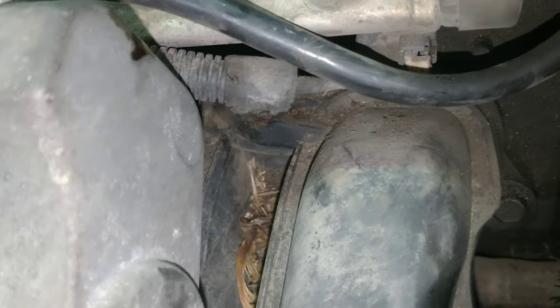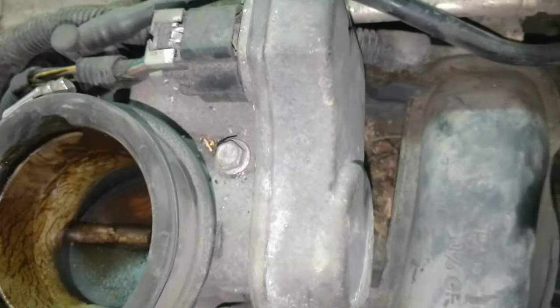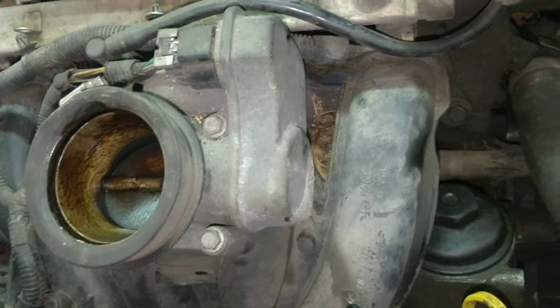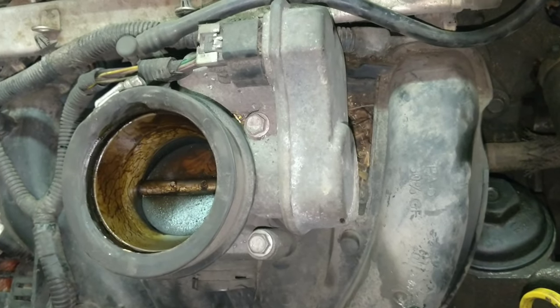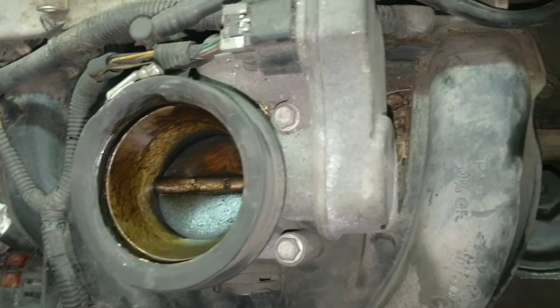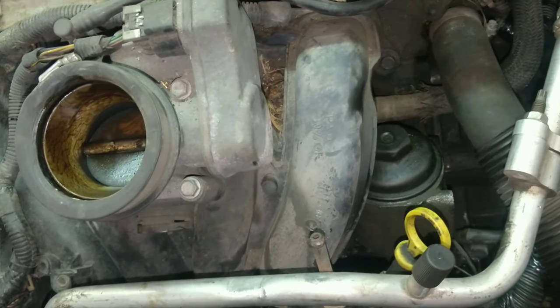You may have a PCV issue. There's actually a small port in these plastic intakes right in the middle, and they clog, and they can cause stuff like this. It's just like a fixed orifice for the PCV. Most people don't know that. And even when you take the intake off to do the gaskets, most people don't even realize it because it'll be so carboned up, you don't even know there's a port there. It's real tiny. You need to use a really small screwdriver or pick.